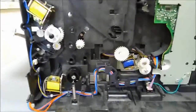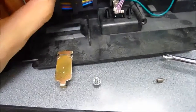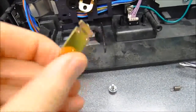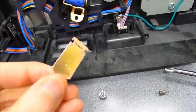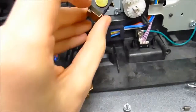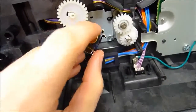So we have to remove those solenoids. Once you have the solenoid removed — just one screw should do it — you can remove the spring from the solenoid that holds the armature in place. You can already see there's all kinds of black gunk caked on the top and bottom there. That's the remainder of the bumper. Here's the bumper right there, and there might have been a little bit of one up at the top as well.